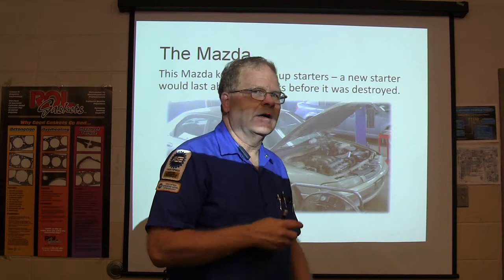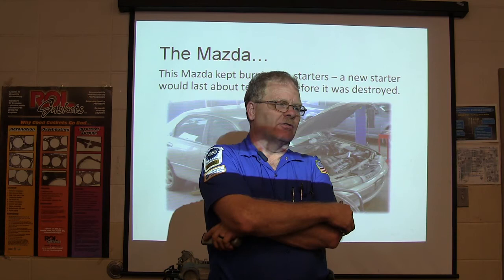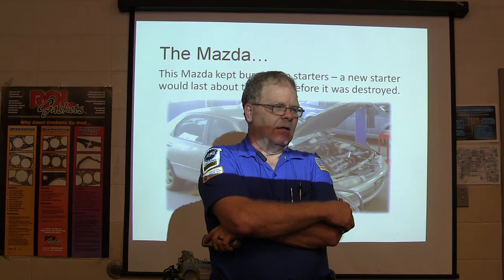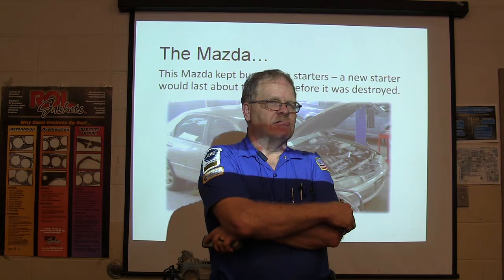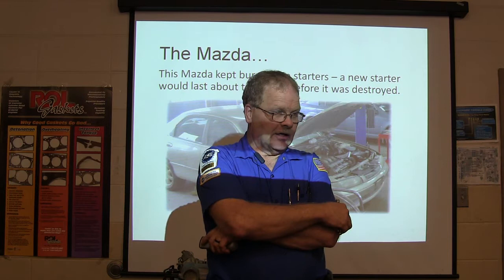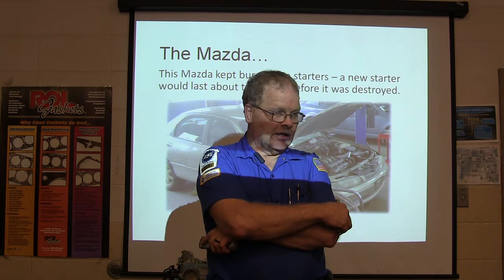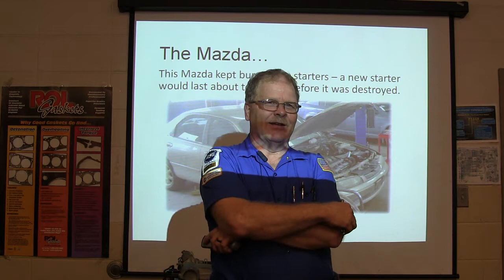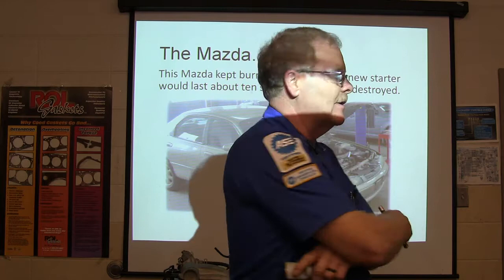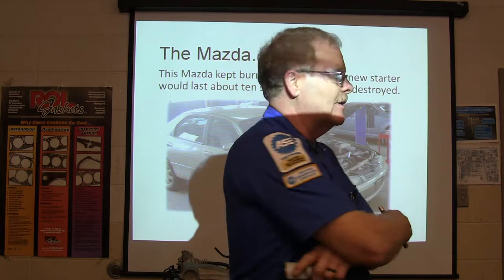So what's going to burn up a starter? Bad connections — or if you've got low voltage going to a starter it'll destroy it due to way too much current draw. When my dad and I took an old '58 Volkswagen bug that had a six-volt system and put a 12-volt generator and battery on it, it would just start the thing fast and never caused any problems — so having a lot of current isn't inherently the issue. This is a strange problem that makes sense after you figure it out, but I'd never seen one do this before. I actually wrote about it in one of my Motorist articles about starter issues.